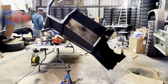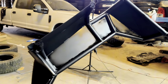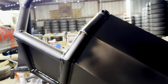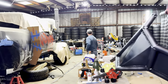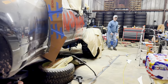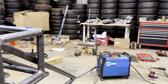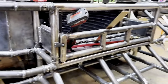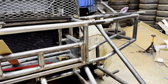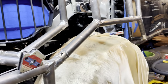All right Steve, what we got here today? It looks like you finished up this side and did a little painting. This is the detachable fender off the passenger side. Next, I'm going to finalize this corner here and just work my way around. We're going to be plating and work it over to the passenger side, put that last tooth in. A whole lot of plating and welding.